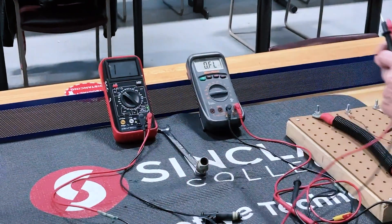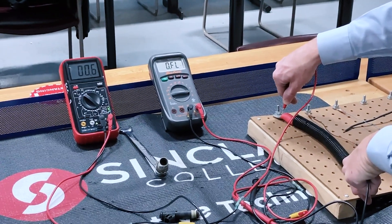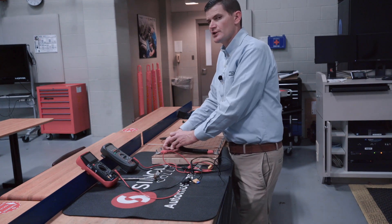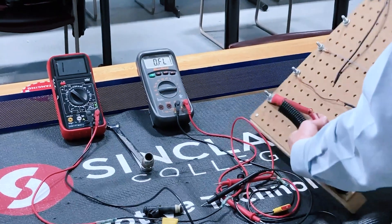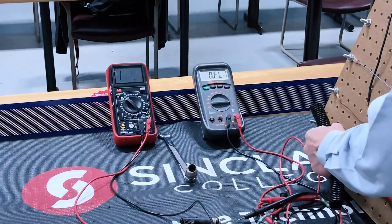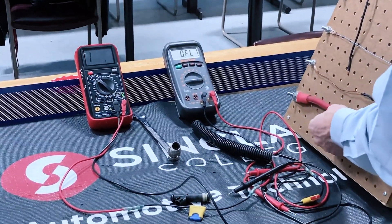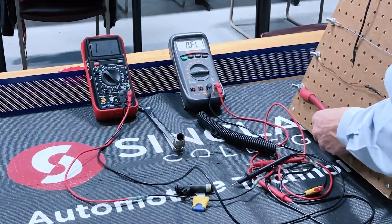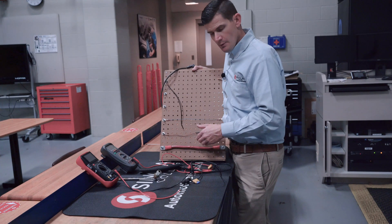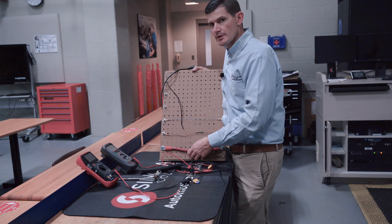On the 200 ohm scale, checking again, we get about 0.7 to 0.8 ohms. Most of us think a low reading means good. But here's the challenge: if we pull back this starter cable — power side or ground side — you can see that the path is not very good. Almost all the conductors are broken except for one or two. It can still pass the small amount of current an ohmmeter uses, so the circuit shows good. But if we tried to pass 150 amps through this on a starter circuit while cranking, there would be a considerable voltage drop. So when checking for high or unwanted resistance on an automotive circuit, I always encourage students to do a voltage drop test when applicable, and to stay away from using an ohmmeter to check for unwanted or high resistance.